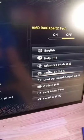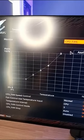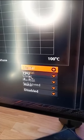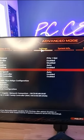Find the fan tuning utility and make sure that all of your fans are actually plugged into the motherboard, and set some form of custom curve. A good place to start is to set it to silent and apply this to all of the fans. If your PC supports it, go to Resizable BAR support and enable this to get a little bit of extra performance.